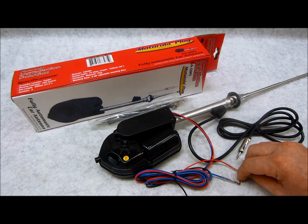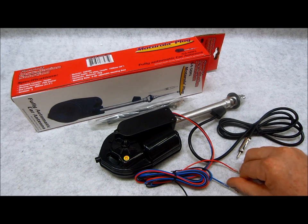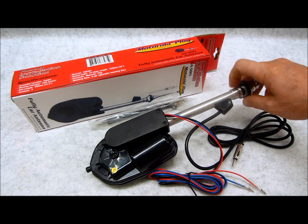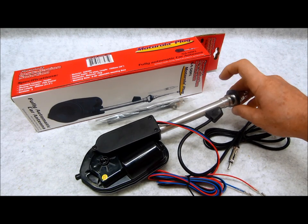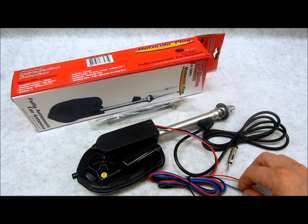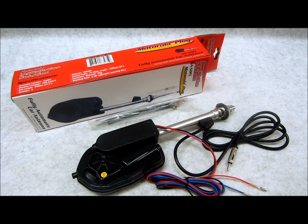And that's really all there is to it. Just keep in mind: red is your constant power source when the key is on, blue is going to be the trigger 12-volt wire, and black is constant ground. Some antennas — I can't speak for everyone — might actually get the ground from the base on the fender. I've never liked those kinds of antennas, but there are some of those oldies still running around. So make sure that your base has ground if you're doing the wiring as I'm explaining and you're still having some trouble. But that's basically how you wire up this or any power antenna.